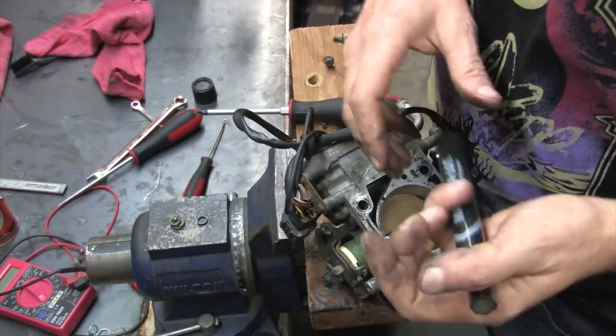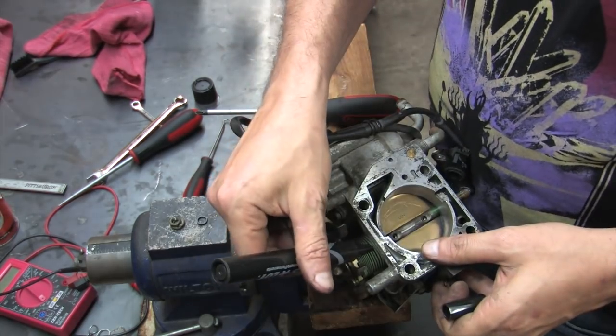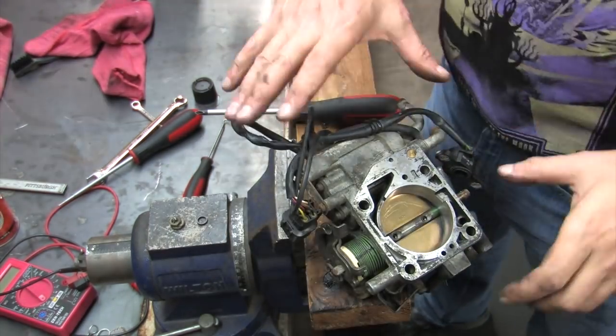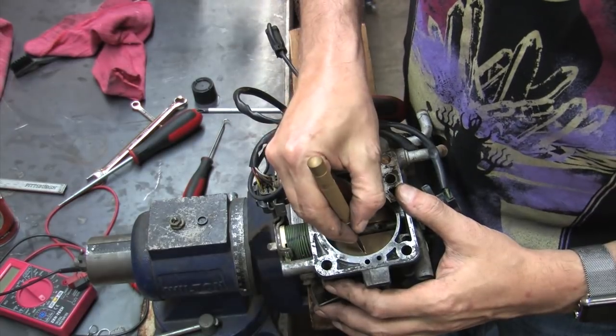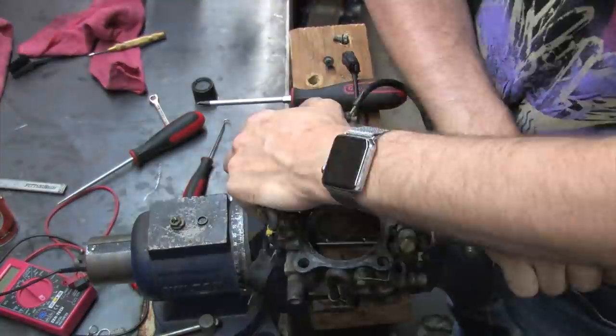I bought this 12 years ago, and it's a well-named product. I mentioned that you can mark your springs to help you get the tension right. Well, you can, and if it's your first time rebuilding a throttle body, you should. Might as well pair that with the task of marking the throttle plate orientation.